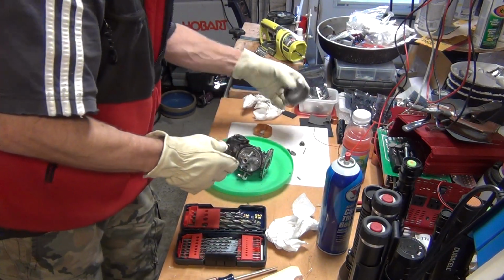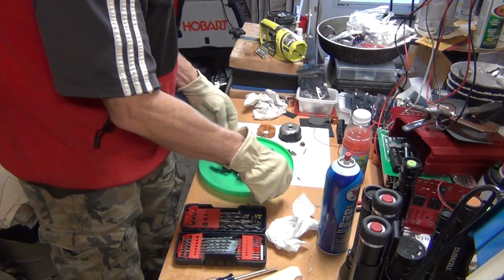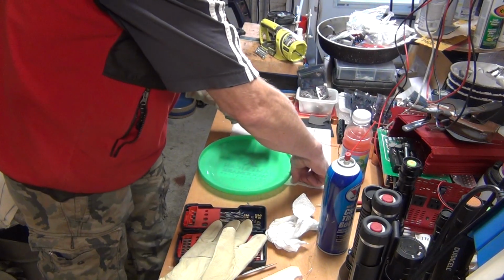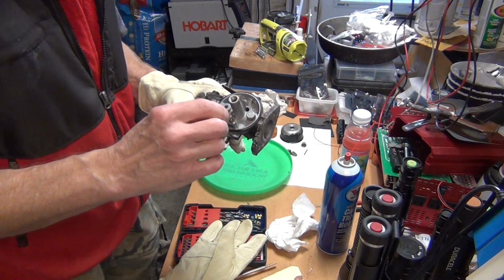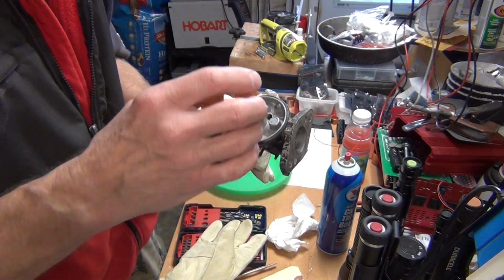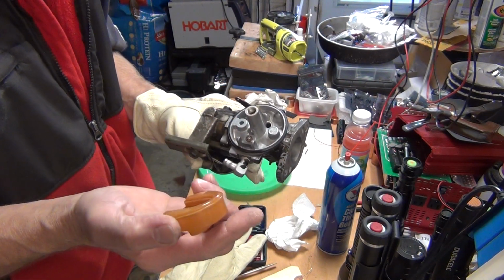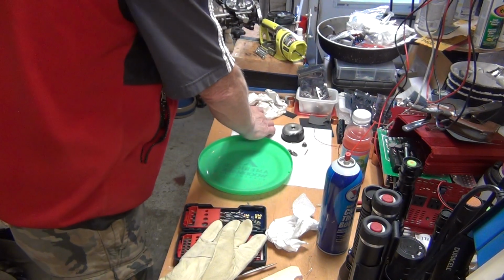I mean, of course you have to clean the bottom pan, the needle, the float. Oh, one thing about the needle, this is kind of disappointing. The needle goes in just like any other needle, but the float is just pushing on the needle, only pushing. It doesn't lock onto the needle, so when it goes down it won't actually pull on it, and that's actually a big no-no. I guess they count on the gas pump